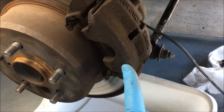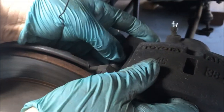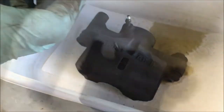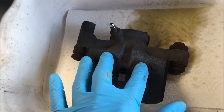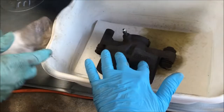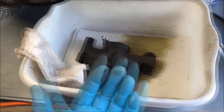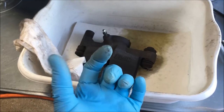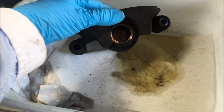This is a 1995 Toyota Camry. Once this 12 millimeter bolt is released from the slide area, this caliper just lifts up and pulls directly out - the slide boots come with it. The brake pads were not wearing evenly, so there's at least a problem with the slides being stuck. We're also going to take the piston out and clean it. If you have uneven wear on your brakes, the first thing to suspect is the slides not engaging evenly - they would be binding and not compressing the brakes evenly. We use compressed air to remove the piston from the caliper.